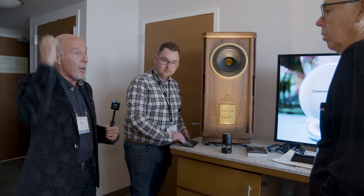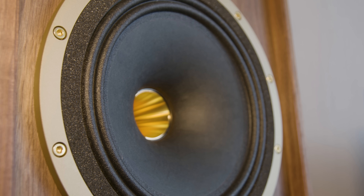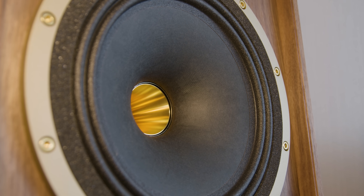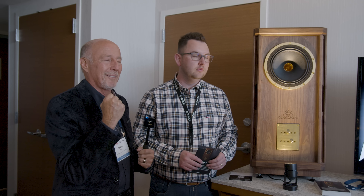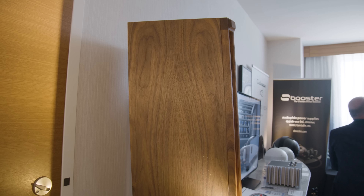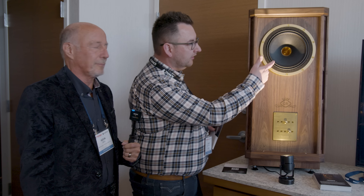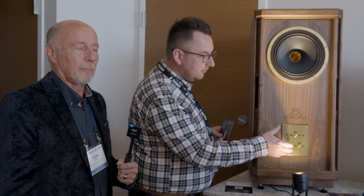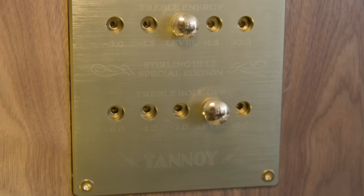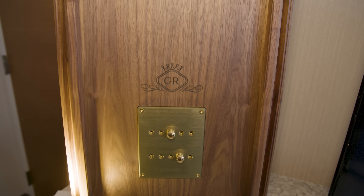They fit beautifully into small spots. The beauty of a Tannoy and the dual concentric driver — and they're the only ones that do it this way — is that they are so easy to place into bad rooms. That's down to a lot of the technology featured in the Pepper Pot and the way it distributes energy flow. We also use a switching panel that gives us the ability to change the energy on the crossover for the treble, and we've also got the roll-off on the bottom row, which helps with room positioning.